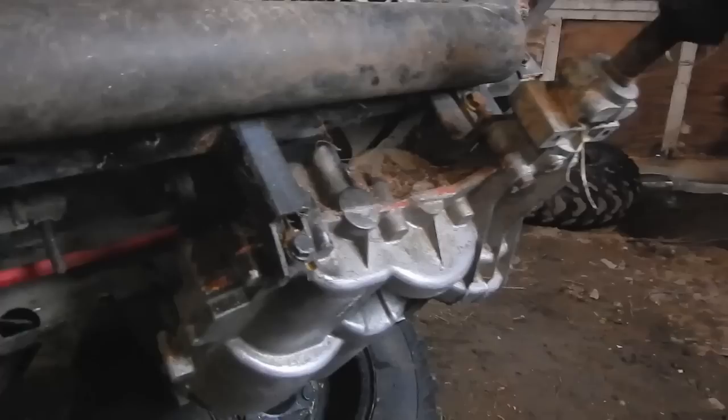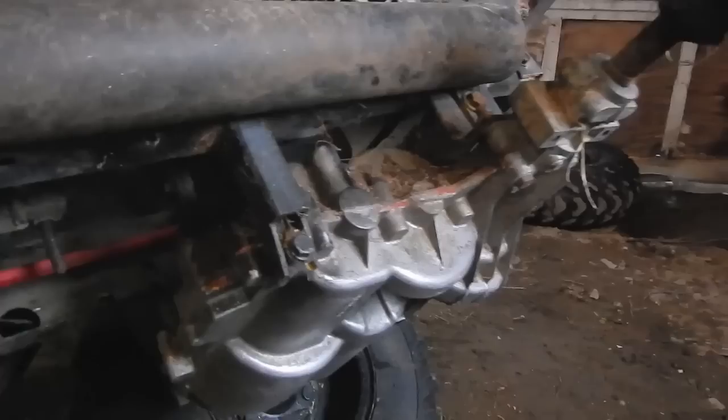Probably my belt gets really hot doing that, I would imagine. I guess I'm glad I caught this, although now it means this project has turned into significantly more than just a front pulley swap. I'm not going to be driving this thing today, which I was really hoping to do. So now I'm thinking I've got to pull that belt off, hoist the whole rear end up into the air, get the transmission out — I've already got it halfway removed anyway. Get the exhaust off, cut those mounts off, put the new ones in place. You're going to have to re-measure for a brand new belt because the whole transmission is going to move back about an inch, which is going to stretch the wheelbase back about an inch — actually a good thing. I'll order another belt once I figure out what size it is, so that's going to be about a week.